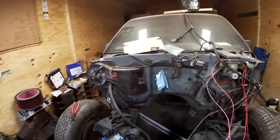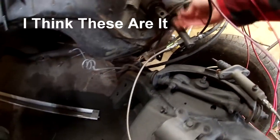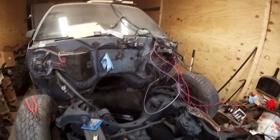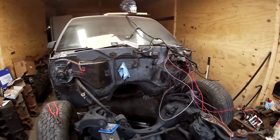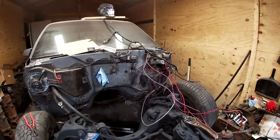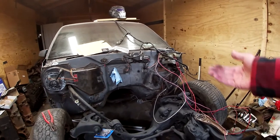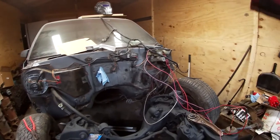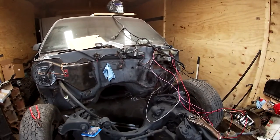As far as my fuel level, I got these two wires that run down along the body here — that's that. But I'm going to a bigger tank with a different style pickup tube in it, so that's going to require a different resistance reading, requiring a different gauge. So that's kind of where I'm sitting on this now.